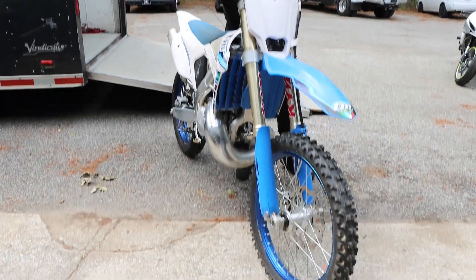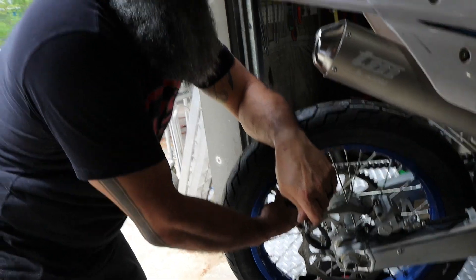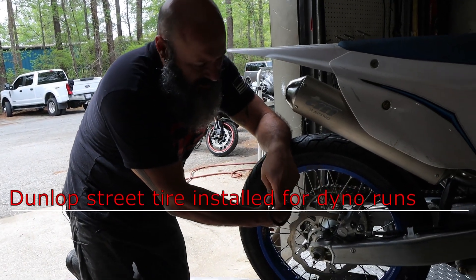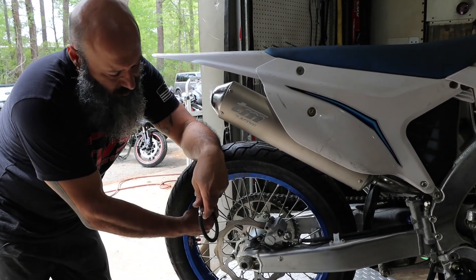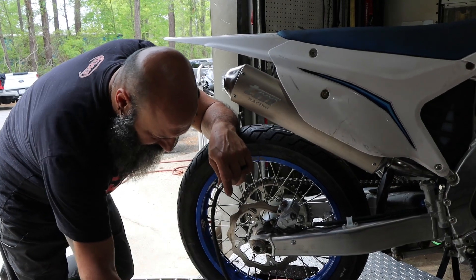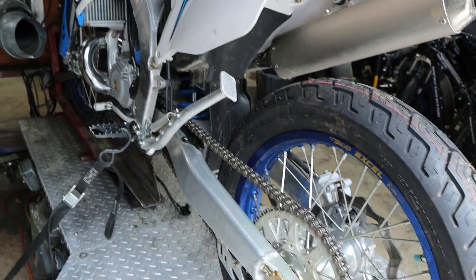So all of our bikes, our standard tire pressure is 30 PSI. We try to get as much consistency as we can. If you're doing a bike in similar weather in a very short timeframe, we always set tire pressures at 30. I will measure how tight the bike is that way. If we were able to do a before and after, then we're duplicating the height, tire pressure, and who's doing it. The only variable we have no control over is the weather.